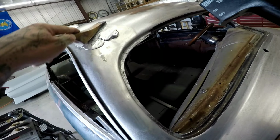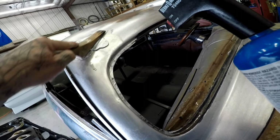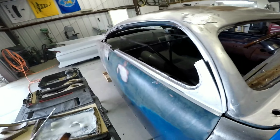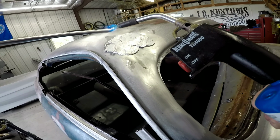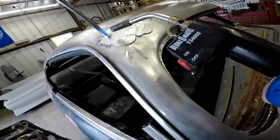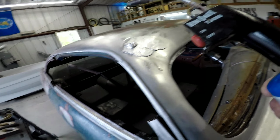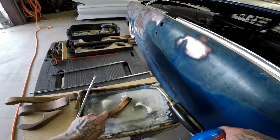Just when you feel like it's getting sticky with the lead, then you go and put a little more lube on there. And I'll show you how to feather the edges so that when you file, you don't have some rough edges to file, because then that's really hard to file. I hope the camera's stable, because I don't want to have to film this a bunch of times. I'm adding just a little bit of lube right now.